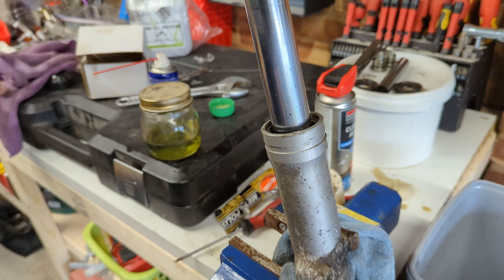I think that's me done for today. I'm going to go have some normal people fun and enjoy my week off and wait for some more parcels to arrive. I think we're getting fairly close now to having a rideable bike. I had a look at the brake caliper, by the way — I'm going to stick it in the ultrasonic. I've ordered a rebuild kit because buying one second hand is a hundred odd quid, so it's probably worth trying to rebuild it. I need to see what I'm seeing, so I've removed all the rubber and everything and I'm going to chuck it in the ultrasonic to bake for a little while, and we'll see how we get on. Peace.